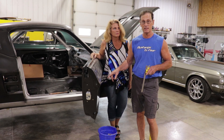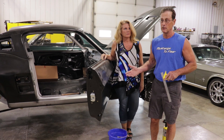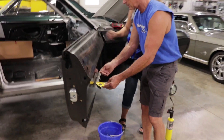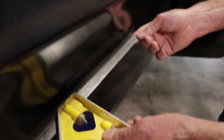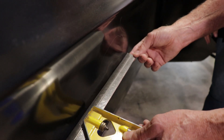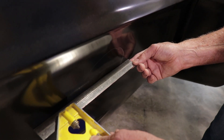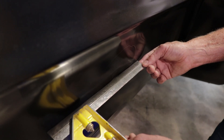What we're going to show you is how far this dent is in. We're also working with aftermarket sheet metal, which is entirely different than the metal I'm used to working with from the 60s and 70s. So we're going to show you what this looks like and give you a general idea of what we're working with. It's stretched pretty good — not the worst thing we've ever worked with, but a lot of guys would probably just grind that down, put filler in it, and walk away. We're going to actually try to bring this thing out so that all we'll need is just a small skim coat of filler and we're ready to block and prime.